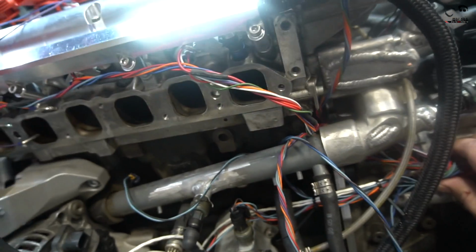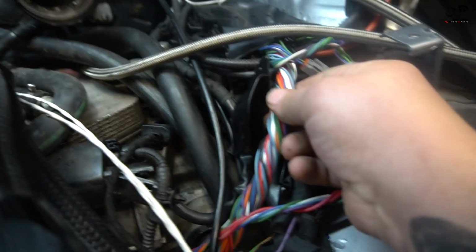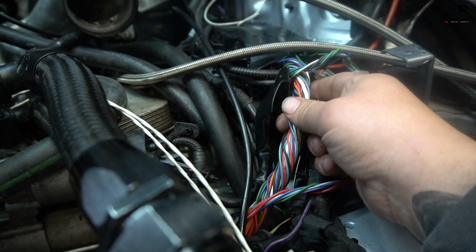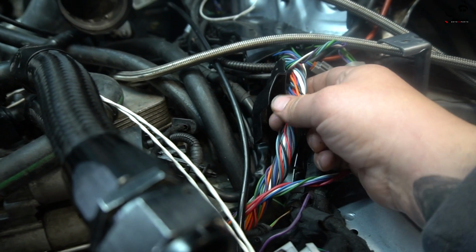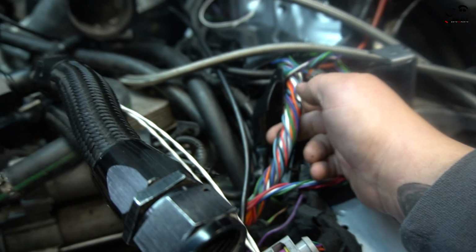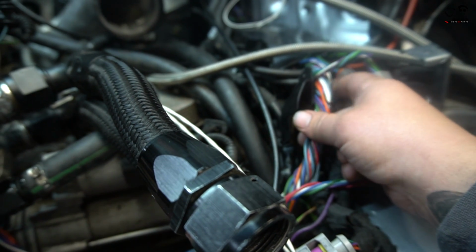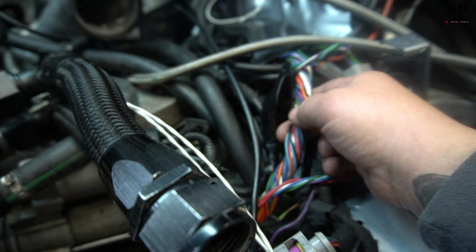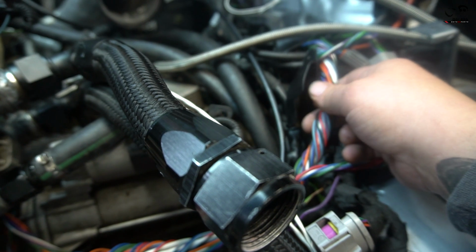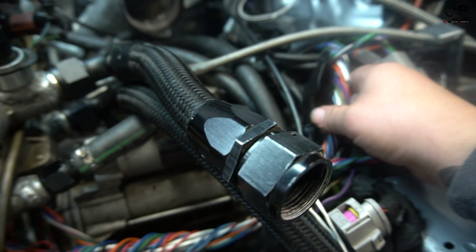But yeah, it's coming out way nicer than I thought it was going to come out. It's also a lot smaller, the harness, actually. When you measure the harness, let's say right here on the factory harness, without the shielding on, it's like 19.4 millimeters thick without the actual heat shielding, the tape that they put on. And this harness, even with the 9 added inputs, and the outputs wouldn't be on this part of the harness, but the added 9, this one is 14, so it's 5 millimeters thinner, which is nicer, again, because it probably would be a lot smaller if we didn't have to add all those extra wires, extra cylinder, extra injector, then on top of that all the inputs for the sensors. But it's coming out really nice.